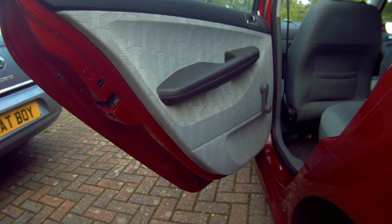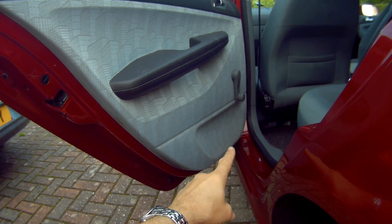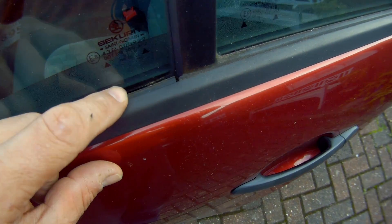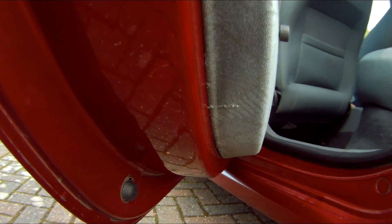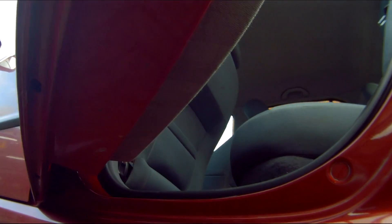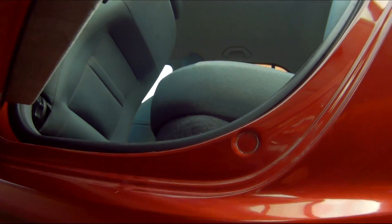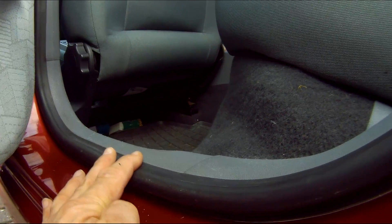This has been a common bugbear with these Mark 1 Fabias, but can be fixed by sealing the bottom of the inner door panel. Water makes its way into the doors, my guess is via the window seal at the top, which then runs down onto the OEM foam seal around the inner door panel, which acts like a sponge holding the water. The water-saturated foam seal then bridges water onto the actual inner panel above the door seal, and you can often feel that the bottom of the inner panel is very damp. Then water steadily drips down onto the inner seal and then onto the footwell.